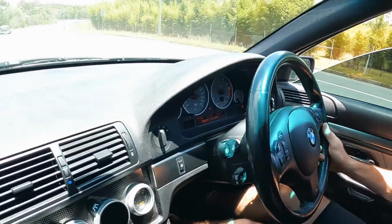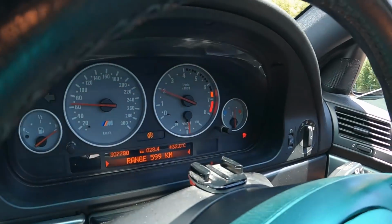I need to get this thing logged. Like HTE said, need to get some logs, see what those temps are doing, because these things are notorious, especially with the Charger, and in this Queensland summer weather. What's the oil temp doing? You know what, I glanced down for a second then. I was trying to look at the AFRs and the oil temp and obviously the road, but the oil temp actually jumped up a bit, just from a little short. It did come straight back down, and this car has got the big aftermarket oil cooler hanging out the front.